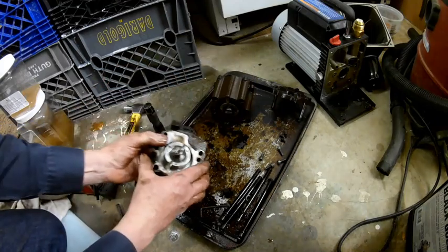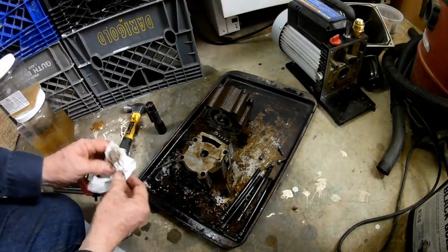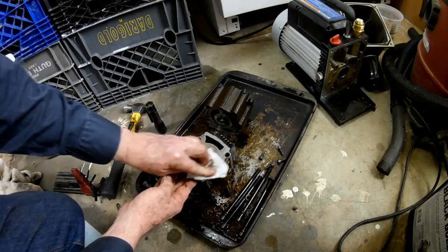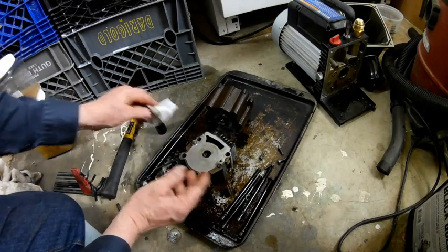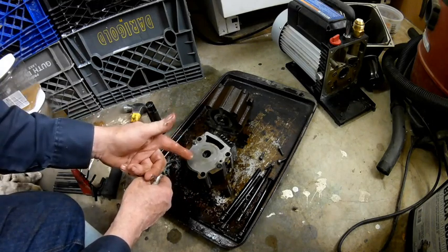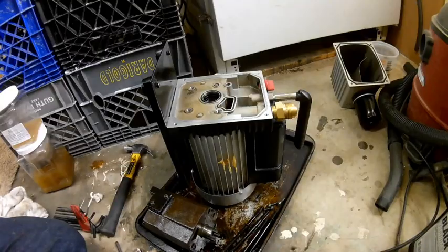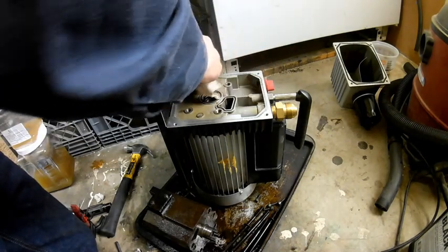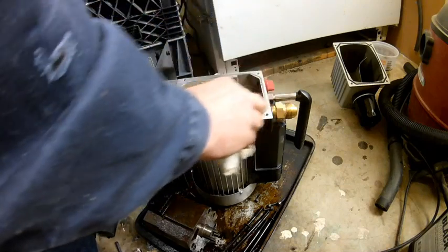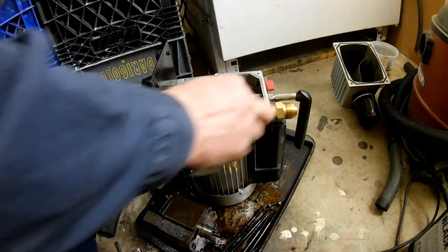It's not a vane problem, so I'm going to have to check some other issues. When reassembling, these machined surfaces are extremely smooth, so you need to make sure there's no particulate matter on the facing sides. When you put the two halves together, any debris will keep them from joining and cause leaking. There are no gaskets here — it depends on extremely smooth surfaces butted against each other to make a seal. If you're going to tackle a project like this, treat it like open heart surgery — keep everything clean and in order.